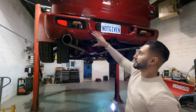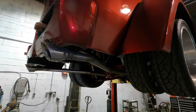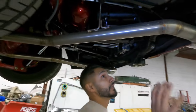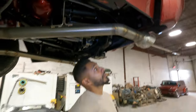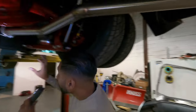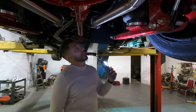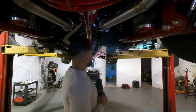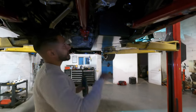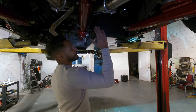On one side, because we had an empty spot, we put an excess battery there — custom fit. On the other side, we wanted to make sure all the emissions were intact, so we put the charcoal canister there, which used to sit in another location but had to move because of all the new components. Everything is functioning as it should from factory. The fuel tank is also custom — it was another lowest point on the Jeep, sitting about here originally. We made it out of cardboard first, test fitted everything, and once nothing was touching the floor, we dropped it off at a fabrication shop to make the tank. Then we bedlined it for protection and made a skid plate for safety.